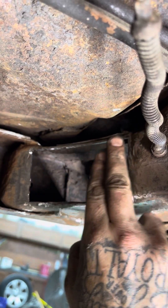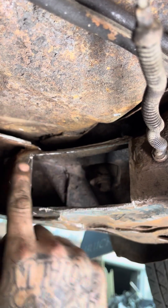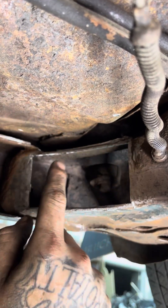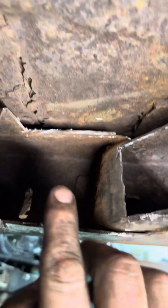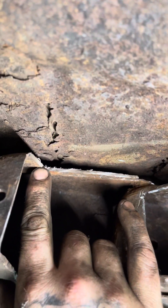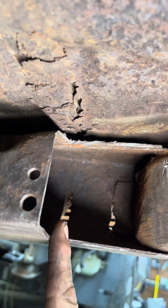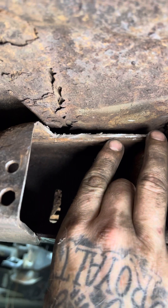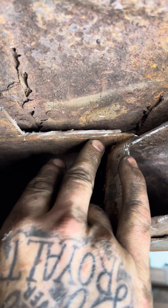I'll make that slight curve in it with a sledgehammer in the vice - just put that slight curve in, get it in there, and weld that all the way around solid. That's going to put the structure back into this piece. Now that leaves me being able to come up here on the top. You can see I got it cut pretty straight - my piece that I cut out here, and I got it cut pretty straight across here. I still need to get up in here and grind all of this down on the inside of the frame really good and clean all of that up.